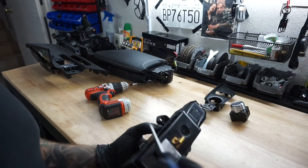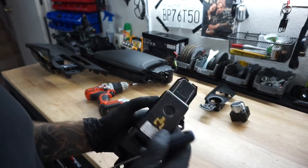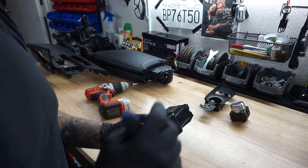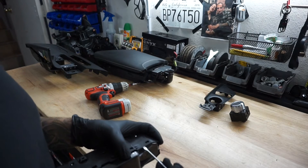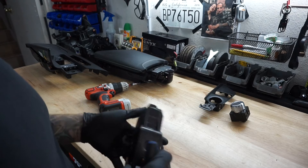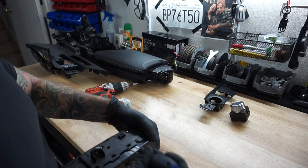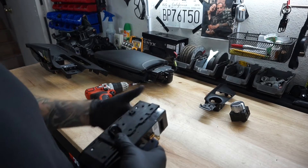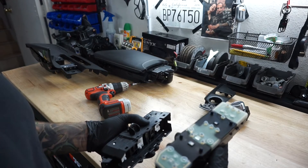Next, separate the shift selector so you can isolate the pieces to paint, wrap, or do whatever you want. There are clips on both sides. The bottom piece contains all the electronics; the top piece is all the plastic pieces that push on the little buttons inside. To take it apart, hold it on its side so things don't fall out. Start from the top and work your way down, then do the same on the other side. Hold onto it as you go because you don't want it to fall. It's going to want to reclip as you work — that's just how it is. Once all the clips are released, separate it. The little plastic piece on top stays with the electronics — keep them together.